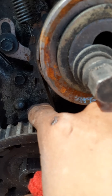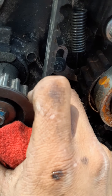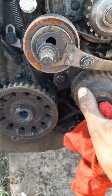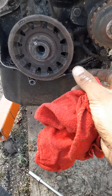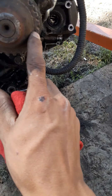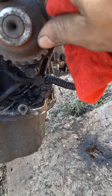Again, you'll see more timing marks down here. I pulled my balance shafts already. Most guys that run Hondas just strip these and run them anyways — I'm gonna do a delete on this. Just trying to catch up and make up for the last couple years because I haven't posted in a long, long time. Your next timing mark is right here — it needs to align with this right here, and that'll be your balance shaft alignment.